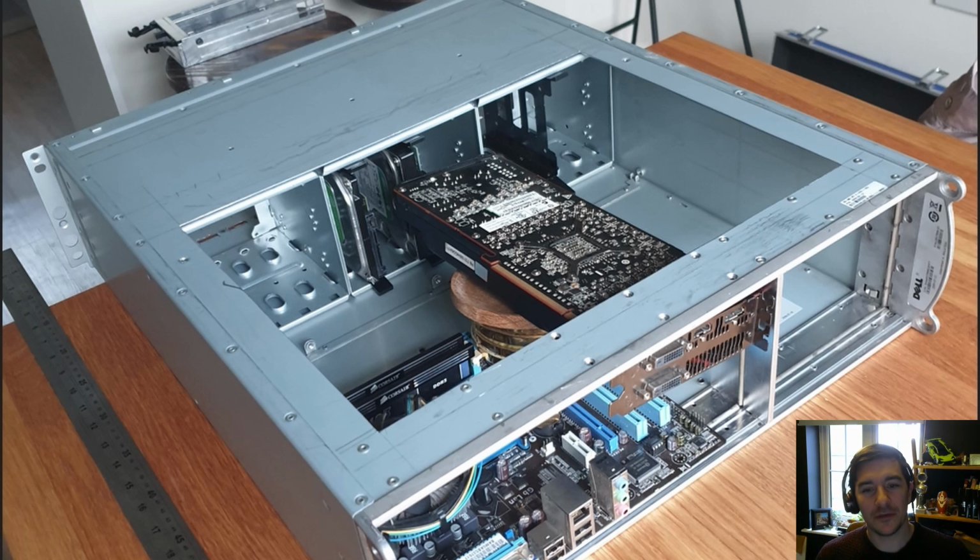Right now the difficulty is finding a motherboard that supports bifurcation, and that is taking a single PCIe slot and then turning it into multiples. But that's a bit of a ways out, and actually there are boards that do that, but they're incredibly expensive, and I was on a bit of a budget.